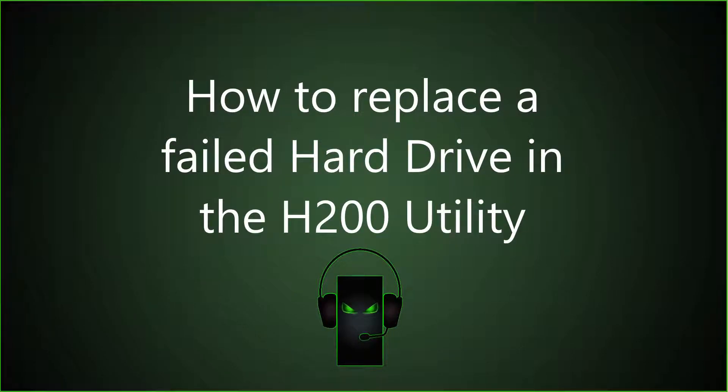This is JBigTicket23 from GrainPCGamers.com. In this video we're going to show you how to replace a failed hard drive using the PERC H200 RAID utility. So if you have a server that has an H200 RAID controller installed, and you might be running RAID 1 or RAID 10, and you have a hard drive that is blinking amber, or your RAID utility is telling you there has been an exception detected and it is currently in a degraded state, this is the video that's going to show you how to activate the replacement drive to get your system back to an optimal status.